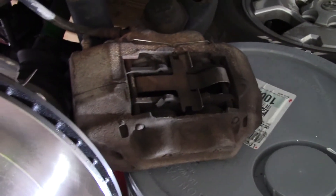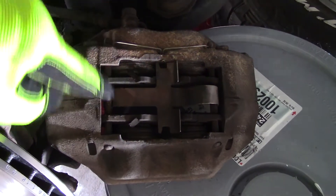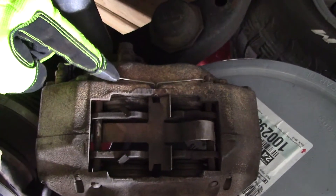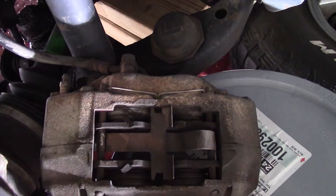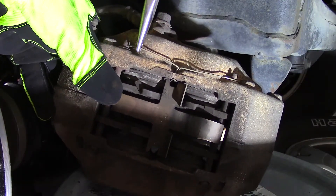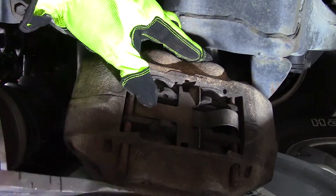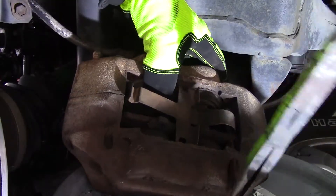This is a quick overview of the brake caliper components. You have the caliper on left and right, you see pins there that hold in the brake pads — these are anti-rattle pins. The pins are connected at the top with an anti-rattle spring mechanism. In the middle of the brake pad there's also another retaining clip. All this gets replaced with the new hardware that comes with your new brake pads, except for the anti-rattle pins — you reuse those, so keep them handy. I'm using pliers to remove the anti-rattle spring clip and pins, pushing them out and shimmying them free.